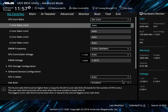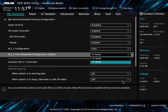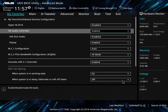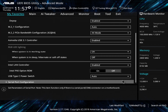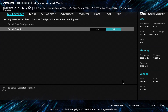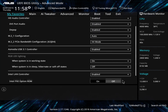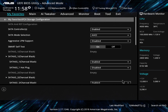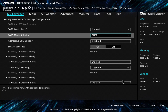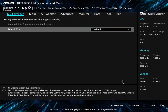Navigate to Onboard Devices. If you have an M.2 NVMe drive like me, set its bandwidth configuration to PCIe 4, otherwise it will not run at its maximum speed. I will now walk through all my screens so you can match it easily, and I will emphasize the most important settings. For sure, disable the serial port. Make sure fast boot is disabled. SATA mode should be set to AHCI. Also be sure that CSM is disabled.